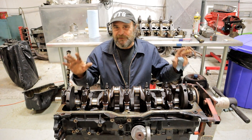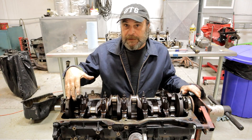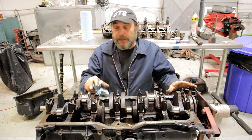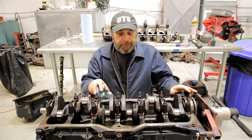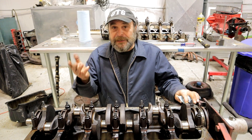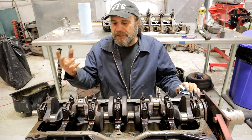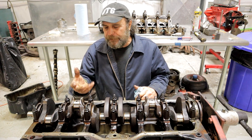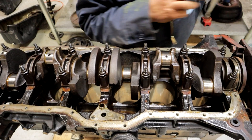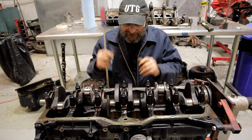In our case, there were no problems in there and we're going to make sure there are no problems in the future. It's a judgment call you have to make — my judgment call is we leave the cam bearings. Now, the crankshaft. Before we unbolt this thing, we want to check how it sits on the block. We want to check the thrust bearing. The thrust bearing on this engine is number three — it could be anywhere on your engine. If you need glasses for this kind of inspection, wear them. You don't want to let anything get past you.